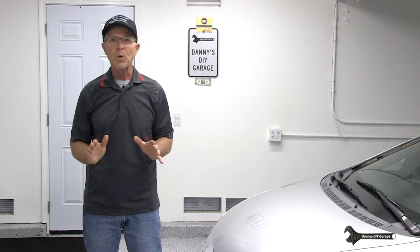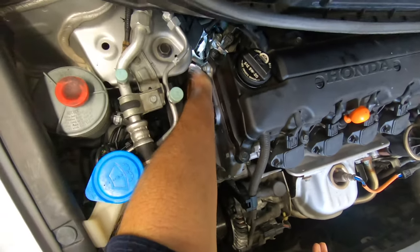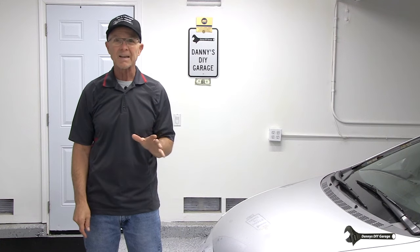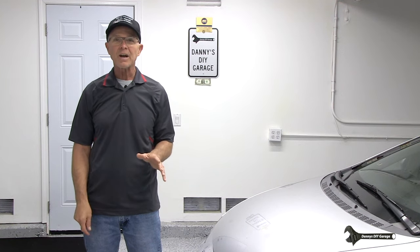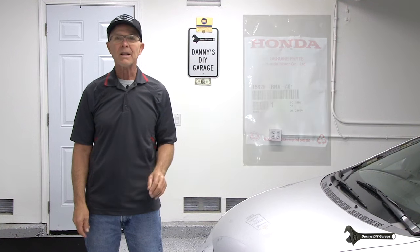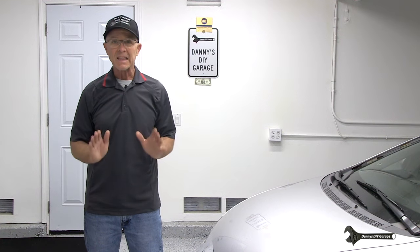Hi, I'm Danny. Welcome back to my channel. In today's video, I'll be repairing an oil leak on my 8th generation 2009 Honda Civic. The oil is coming from the right side of the vehicle at the spool valve, or they call it the VTEC solenoid. This is a common leak, and both my Civics are leaking there. If you have an oil leak on the passenger side, pick yourself up a gasket from Honda. The part number is 15826RNAA01. Make sure you watch the whole video because there's some important tips along the way. Let's get started.